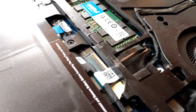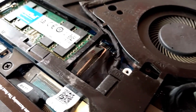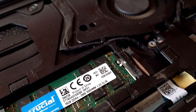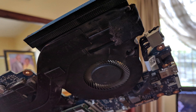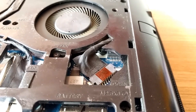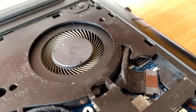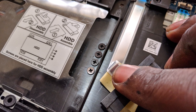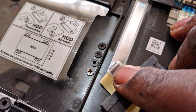The screen cable has a thin plastic ribbon positioned right above the connector. This is supposed to be used to disconnect the display cable — pull on it gently, alternating on either side, until you can pry the connector loose. Also, just as Bob mentions to reposition the power cable when reassembling the laptop, it is equally important to free up this cable when removing the motherboard, as it is positioned on tabs within the inner plastic housing. Finally, don't forget to remove the four screws underneath the SATA cable, as these connect the inner plastic housing to the upper part of the chassis.